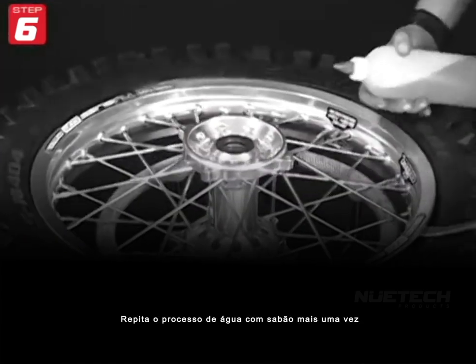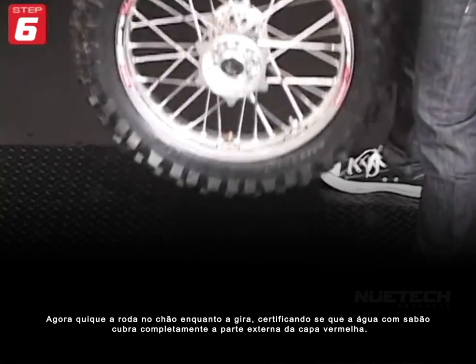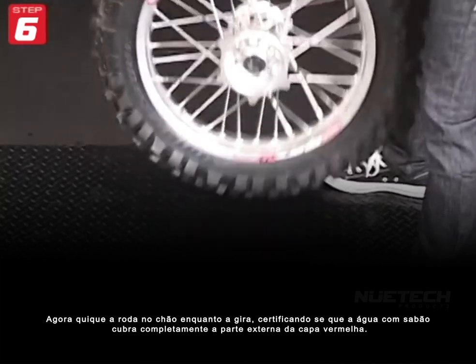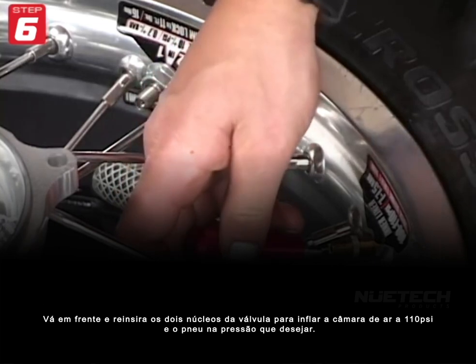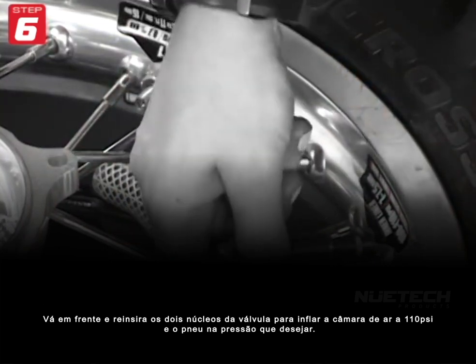Repeat the soapy water process one more time. Now bounce the wheel on the ground while rotating it, making sure the soapy water completely covers the outside of the red liner. Go ahead and reinsert both valve cores. Inflate the bladder to 110 psi and the tire to a desired air pressure.